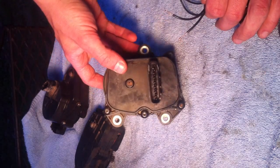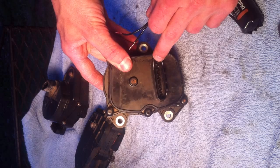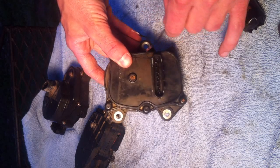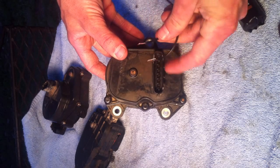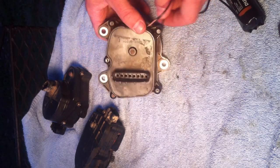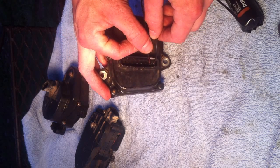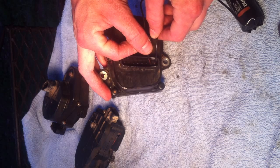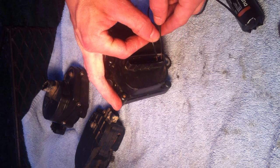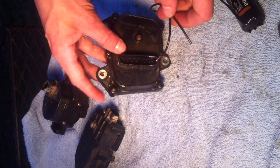Let's start with the 3B4. I believe this one mounts like this on the back. These two terminals right here on the end, where I have this little silver mark — those two terminals are what you want to test. Turn it one way, all the way, then flip these wires around and do it back the other way. That's a good servo.